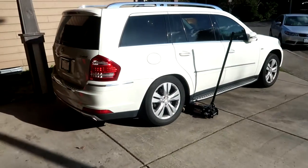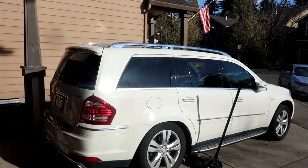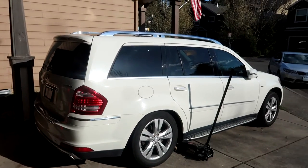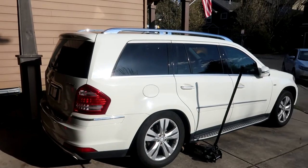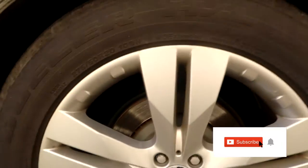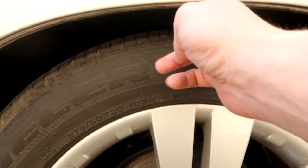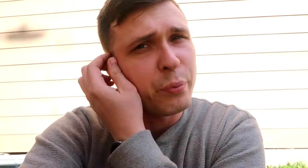We are doing this job because the rear airbags have failed. The compressor works — when the vehicle runs it does raise up, and if you drive it throughout the day it's totally fine — but overnight this is what happens. This Mercedes is sagging on both sides. You can tell right here the gap is extremely minimal; I can't even get two fingers in. But the job is pretty straightforward, and if your compressor is working as it should, you most likely have a leaking airbag.